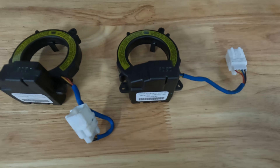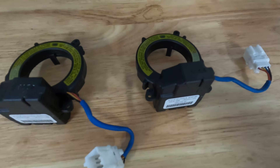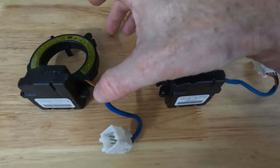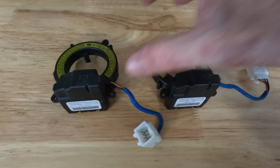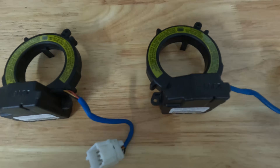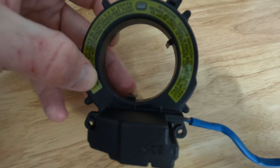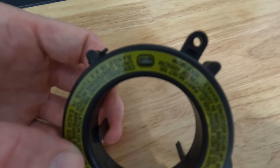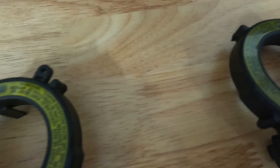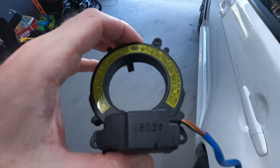Fast forward — it's been a couple of days. Huge shout out to the DFW Evo Club; it's been a huge resource. I was able to source a sensor — a brand new one online was around $200 to $250. I just had to drive about an hour and picked this one up for $80. Let me show you the difference between the good one and the bad one. One thing I was mistaken on is that when you turn it, I thought it had to be lined up with the two little black arrows. That is actually not the case — if you turn it back just slightly, you can barely make out the top of a square at the very corner, and that is what is supposed to be lined up in the glass. Super excited to get this thing installed and then do another calibration.